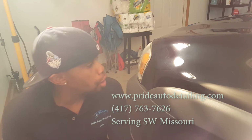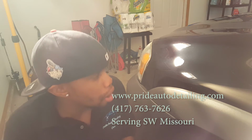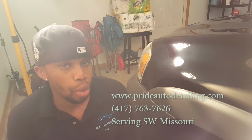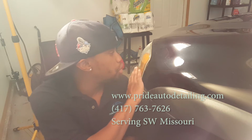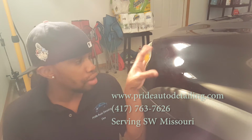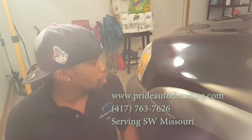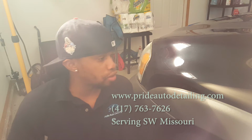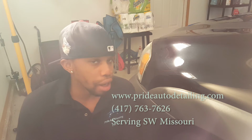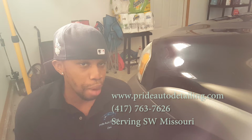So now that, you know, 90% of the scratches have been taken out with the one-step polish, what we're going to do next is go ahead and put a coat of paste wax on there, and then that's going to further hide the very few remaining scratches, as well as give this fender a really, really nice looking shine. As I said, this was just a one-step polish, so some of the scratches we weren't able to take out with that. But there are two-step polishes using a stronger compound and the jeweler's polish.